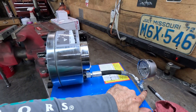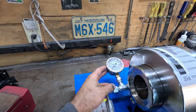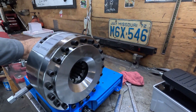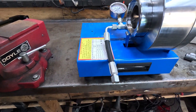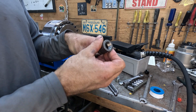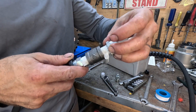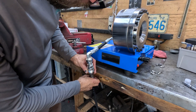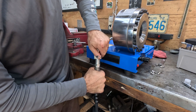Before connecting that fitting, I'm going to reconfigure this hose and gauge setup into a position that feels more comfortable — so I can hold the hose on one side while keeping an eye on my fitting getting crimped and watching the pressure gauge. When hooking up o-ring style fittings you don't need teflon tape, but don't forget to put teflon tape on all MPT or pipe thread type fittings. Note that this 3/8 MPT female coupler is actually rated for gas pipe; for hydraulic systems you're supposed to use stainless steel connectors rated for higher pressures, but for the pressures I'll be operating this tool at, it will be fine.